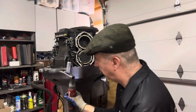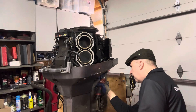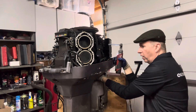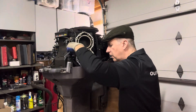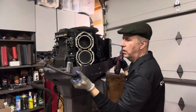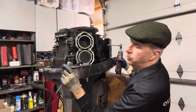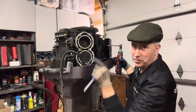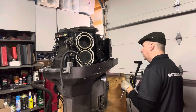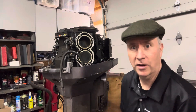The cowling has bolts through here — I got this one loose already, and we have one here. We already disconnected the wires for our trim switch so we can come out of the motor, and there's a broken one that goes to our pisser tube here. We're going to make sure we disconnect those hoses and then pop these covers off.